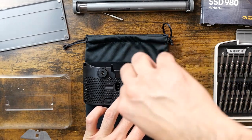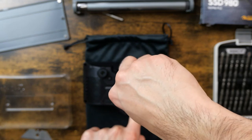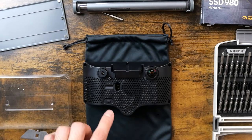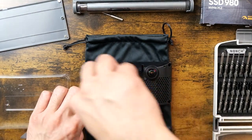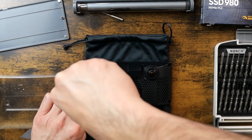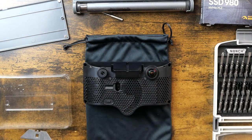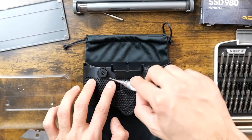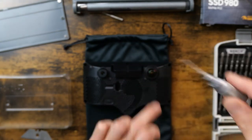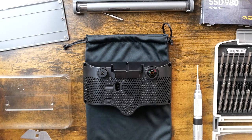All right, so be very careful with this one. I'm actually gonna put some slight pressure on the clamshell so that I'm not relying on myself turning the screw head to get those screws tightened. In essence I'm pressing down on that so that I'm not having to fight the clamshell while I'm trying to turn the screws, because it's likely that this is not the right screw head. So I am risking stripping out this little bolt if I am putting tons of torque on there, and I'm pretty happy with that. All right, let me get a power adapter to see if this thing still boots. So give me 1 second.